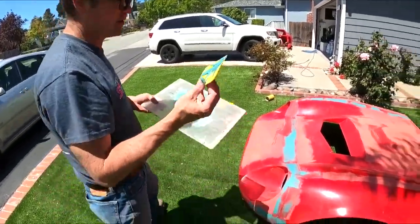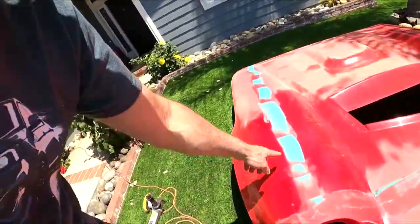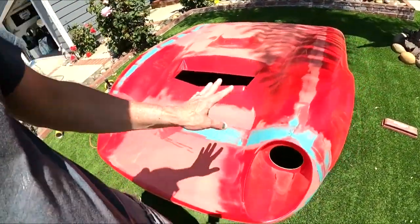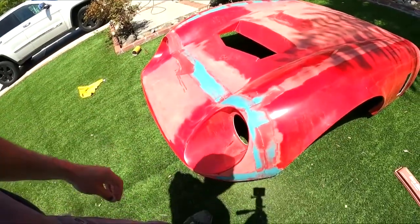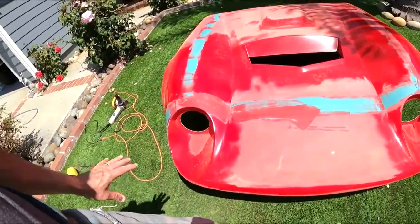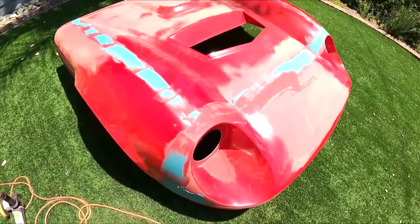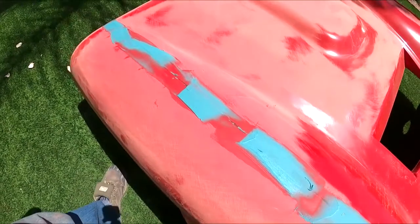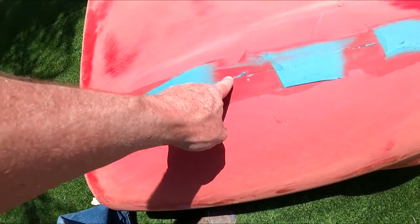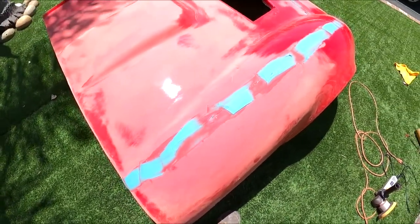Alright, it's done — it's not workable anymore. I'll wipe this down with some acetone and clean up my fingers. We got our first coat — we didn't cover everything since it started hardening up, but I can already start sanding that stuff. It's quick and simple: hit it with the DA to knock it down, then we'll skim coat it with Rage Gold, which is my go-to body filler, and then we'll be getting close to getting this thing ready for primer. This short strand fill is just to fill in those gaps — it's strong as hell with the fiberglass Kevlar reinforcement.